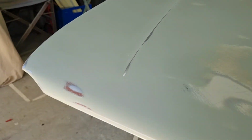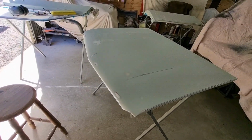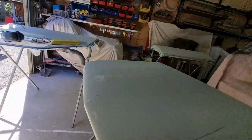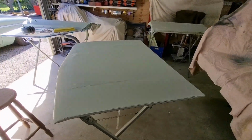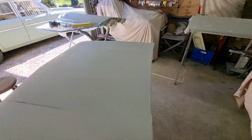So yeah, they've completely disappeared. So I have got sand-through spots, so I'll go through that with the 1K sand-through primer. I haven't yet done the back of this hood, which I will do, and I also need to do the welding underneath the latch under here, which I should have done before, and I'll probably be saying later on that I should have done it before doing all this so that I didn't burn the paint off, but I didn't do that.